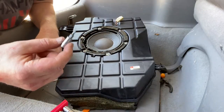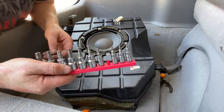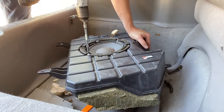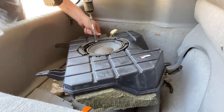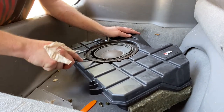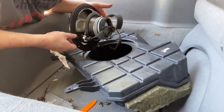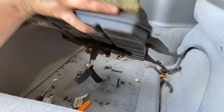And there it is — it's in pretty rough shape, wow. The speaker screws are Torx, so let me go find out what size that is. The lucky number is T20 — T as in Tom, 20. Get yourself Torx bits; you can get them in a screwdriver set as well. Look how pretty she is with the speaker off — I'm going to get all the dirty pieces out of there.